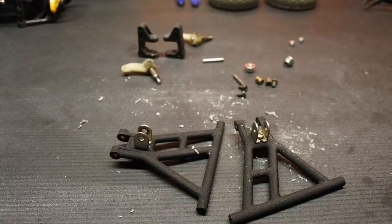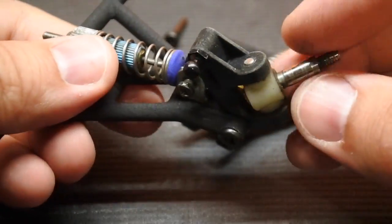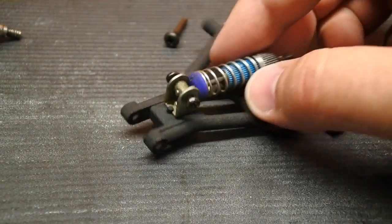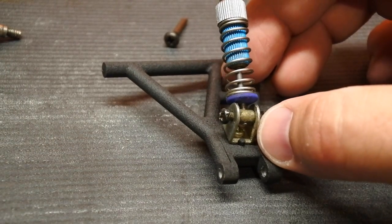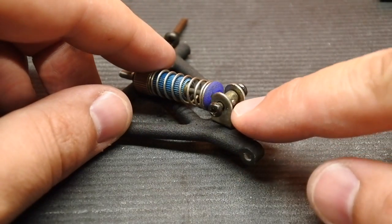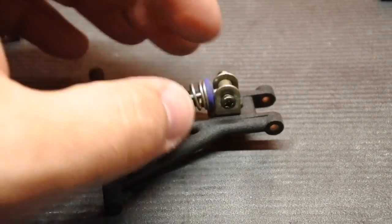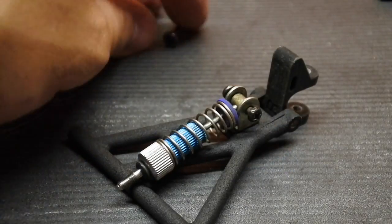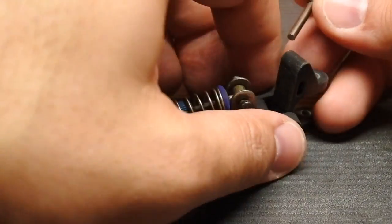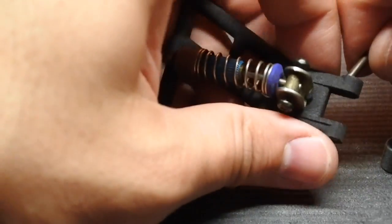These arms are ready to go — I'm going to grab some screw pins and begin the install. I went ahead and assembled this side of the suspension. You can see by the L right here that this is going to be the left side on the Hornet. I went ahead and put the UG front shock on this vehicle. Although many of you just have the stock front shock and springs, there's not going to be really any difference — you're going to have this metal bracket here already, so just go ahead and install the kit-supplied plastic mount and then thread in your friction shock. These are Tamiya screw pins — they can be found in Tamiya kits spanning decades. I simply typed 'screw pin' on eBay and ordered a generic kit.